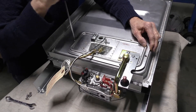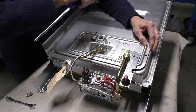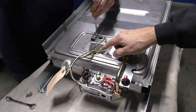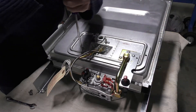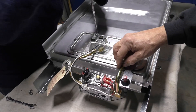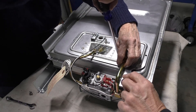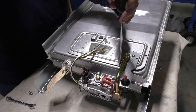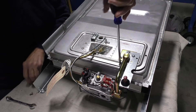Debbie's putting the screws back into the control plate. All the components for your thermocouple, sensor, and the gas going to the pilot are up here. You've got gas going into the orifice on this side that goes inside the burner, the control unit down here, and the place to attach a thermostat is in this area. That's all outlined in the instructions. And this is the igniter — this black wire up here runs to it. There's also a window so you can view the lighting process when you're lighting it.